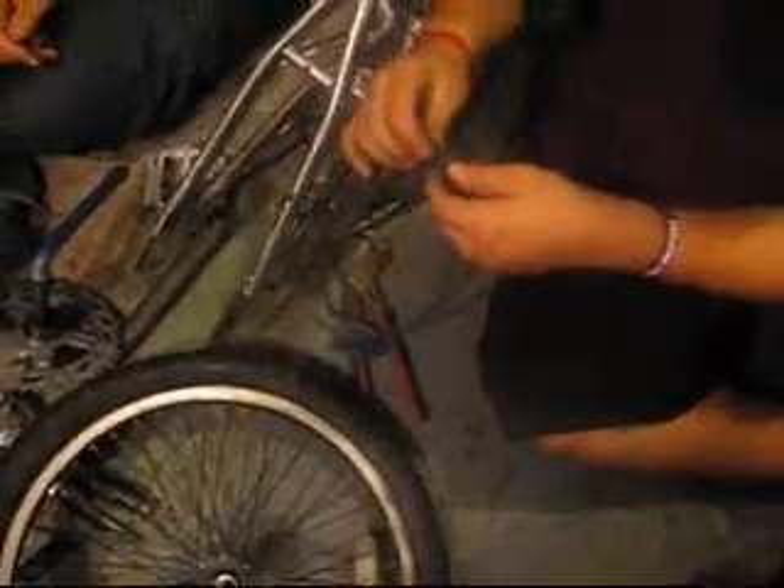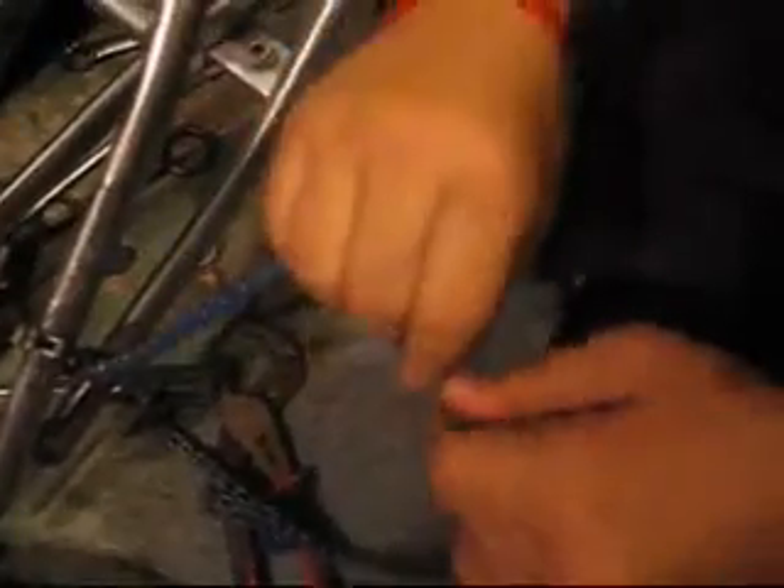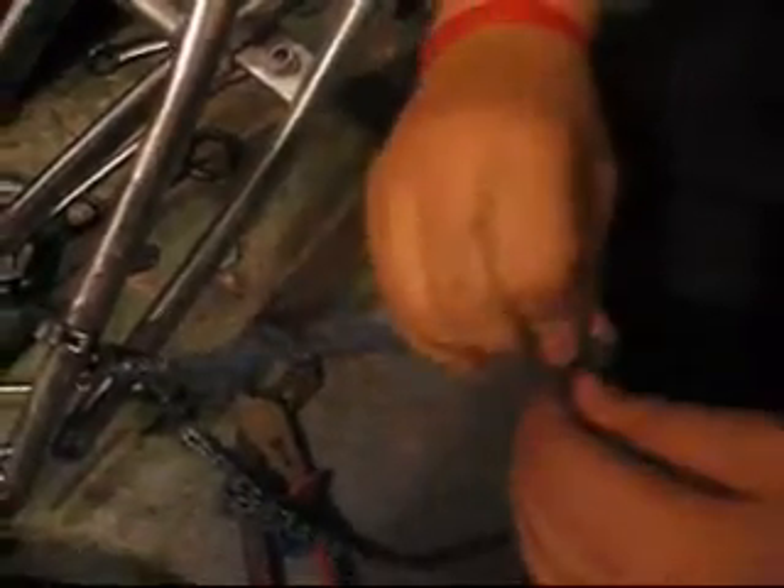We'll hold the bike on the proper chain. This bike does not have a master link, so I already popped it off. It's very easy — you just take a screwdriver, wedge it in here, and then you hit it with a hammer. Then this part will just come down. Very simple. If you have any questions about it, I'll show you in another video how to take it apart later on.